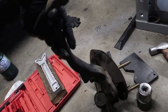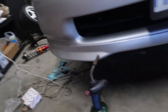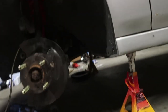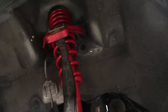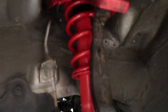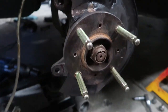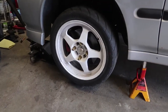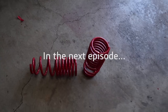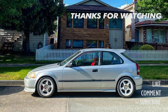We're going to do the front coilovers really quickly — just swap these springs out for the Skunk2 ones and then everything gets reassembled and the front's done. Hub is back in, spindle back in, new spring put in. Pretty much ready to go on this side — just going to put the brakes on and we're good. Front's all done, just going to the back for these springs.